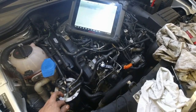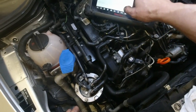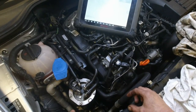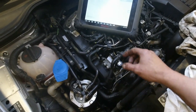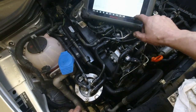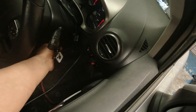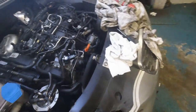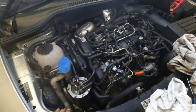I'm pretty happy that canister's filled — that was running for about 30 seconds. I'm now going to run the supplementary pump to push diesel toward the high-pressure pump. You can hear the fuel going back into the tank and hear the tank bubbling at the back of the car. That's enough — we'll go ahead and start the car. Start right away — no problems at all. Check for leaks — good job.